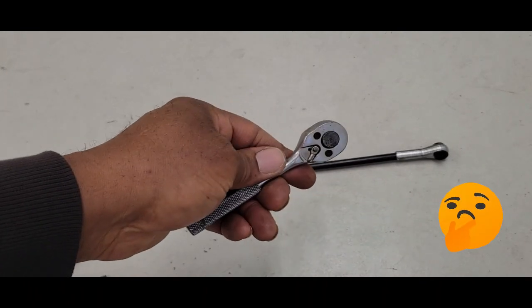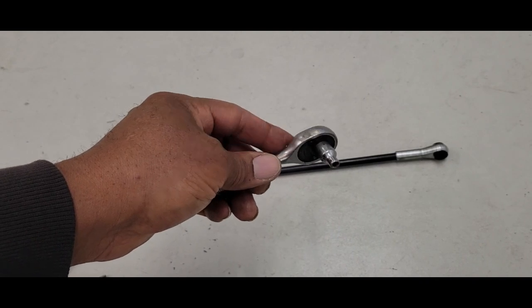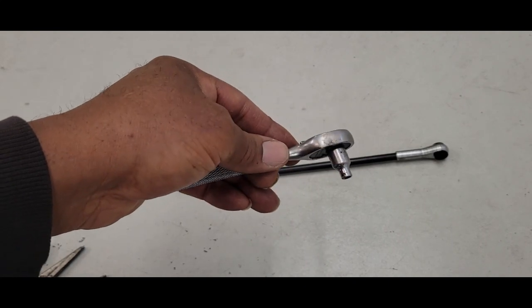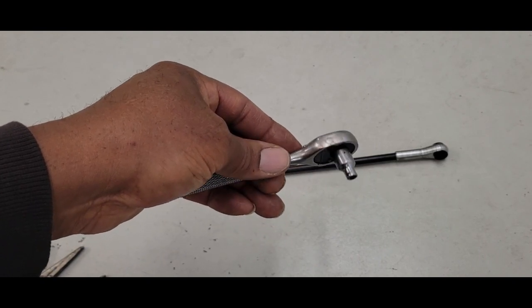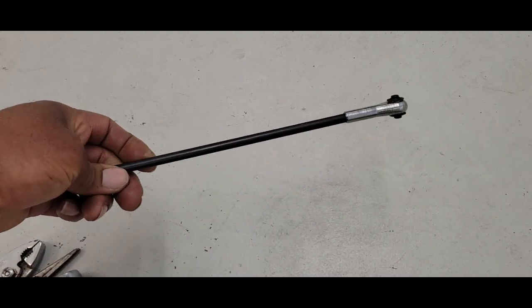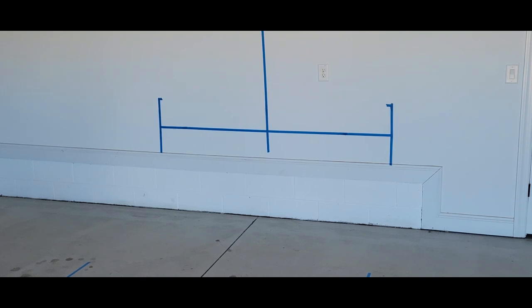You may feel like you can use a four millimeter, but I have a 5/32 here and it fits perfectly — it's a six-point — with a flat quarter-inch ratchet. The problem is you can only use that if you're adjusting left and right, and once you get your adjustment right, chances are you won't be able to get that tool out. So take the time to actually get the proper tool and your job will go a whole lot easier. Now we're at 25 feet from the wall. I'm going to turn on my headlights — I've put on brand new headlights, so I know the reading will definitely be off.